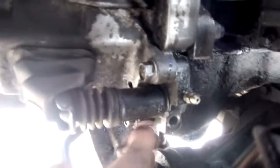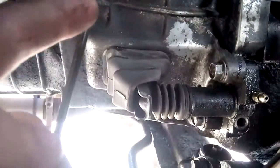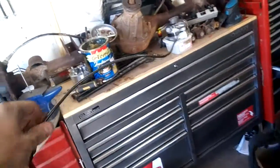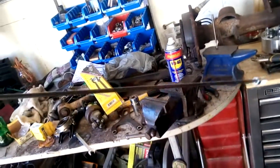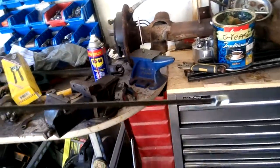As you can see it's going around the corner there. Now it's just going down. We have to get it right into there — it's still a little long. We're getting pretty close now, we just got to put a bend in here. I'm probably going to have to put a 90 here and then a 90 from this way to that way. So I got to take it back out of the truck. I had to put a 90 down here where it's at the bottom of the truck — that's where the firewall is. Sometimes you just don't have enough room underneath the truck to bend it, so you got to take it back out and then put it back in again. I'm probably going to have to shorten this piece a little bit, just by putting like a zig-zag bend into it, because it sticks a little too far.